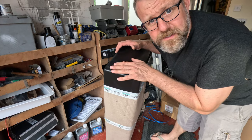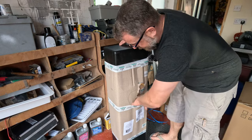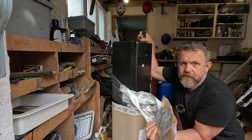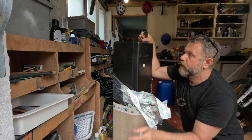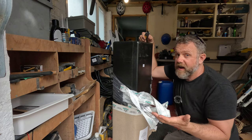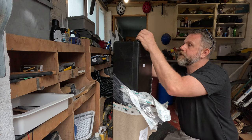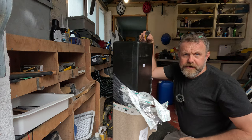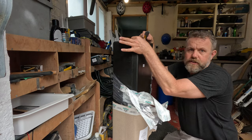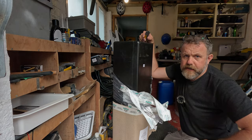And then finally this one, which is not really a surprise as to what it is. They didn't hide it in the packaging very well. So this is my waste water tank. This has come with some straps to hold it underneath the van. I didn't order the one that comes with pipe fittings because you know what it's like when you buy something like this as a kit with all the fittings, and I'm sure they'll be fine, but being a plumber, I'd rather buy the bits I want. I want to make sure I get a big enough inlet for it because stuff going down the sink and down the drain, I want to make sure it doesn't block and it goes in all right. And I've seen that some of the kits, they send such a tiny little pipe for it to fill. And I just don't think it's any use whatsoever, really.